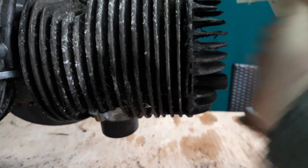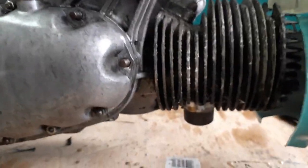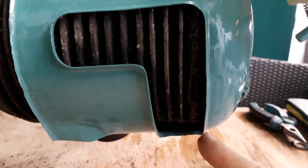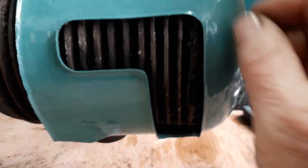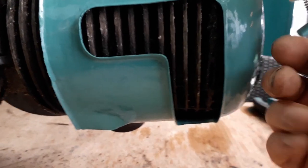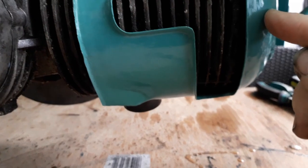The other thing you can do is modify this cowling and literally cut it away here, then recurve the lip, and allow some airflow over the top of the cylinder head. That helps a bit.